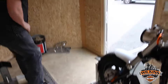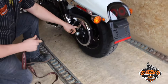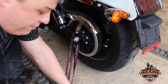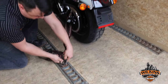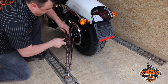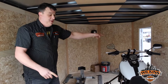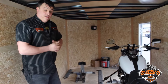We're going to repeat the process on the back end of the motorcycle. Take another strap back here — I like to go around the swing arm, one on each side, and pull it back. Hook to your floor mounted position, pull the strap out of your ratchet strap, and start to tighten down. Now you have your two points — your front and your rear — done. You'll want to repeat the steps on the other side, so you have four points of contact securing the motorcycle and you'll be good to travel.